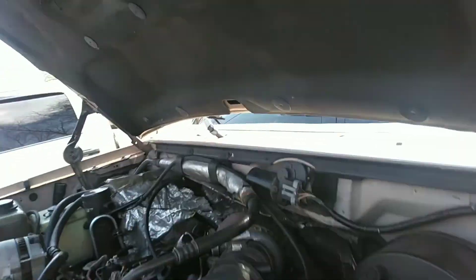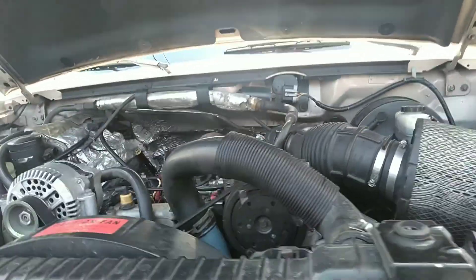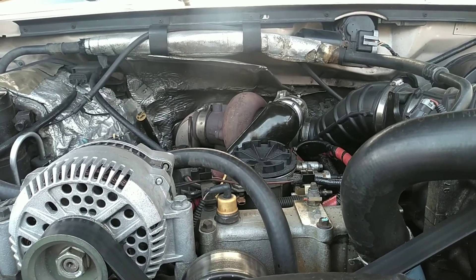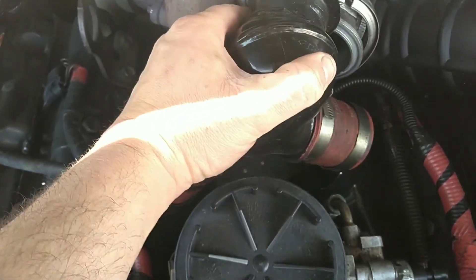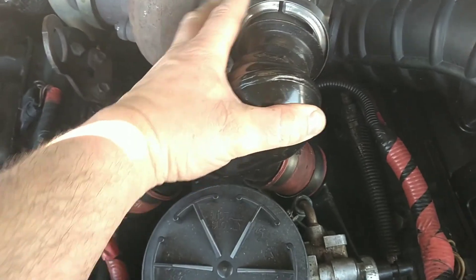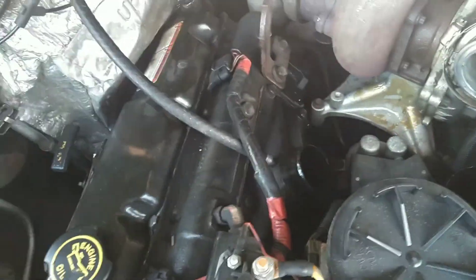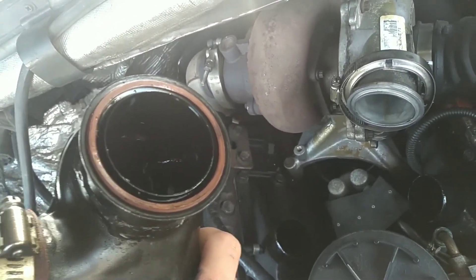So let me get a few things off here. We're going to be replacing this fuel pump. Bill Hewitt over at PowerStrokeHelp.com has a real good video on these — I might miss some steps, but I'll try to show most of it. Step one: you've got this boost intake pipe that sits right here with a clamp on it — eight millimeter. Take that clamp loose. This is basically where all your boost goes into. Old school, no intercooler. Take that off, and when you do, look at the gasket — you might want to just order a new one if you're doing this job.